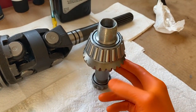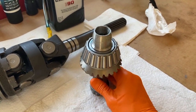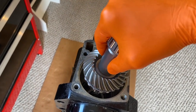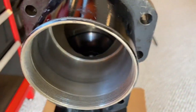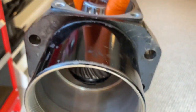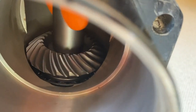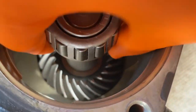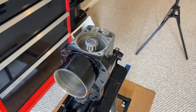This is all lubricated and greased. We are going to grab the vertical gear and shift it into the upper unit. As you can see, it is going to go down and align properly with that lower seal — it should go in very conveniently. Give it a couple of rotations. Everything looks good. There is clearance — no binding, no scraping, no scoring — and we are satisfied with that. That is what it looks like so far.